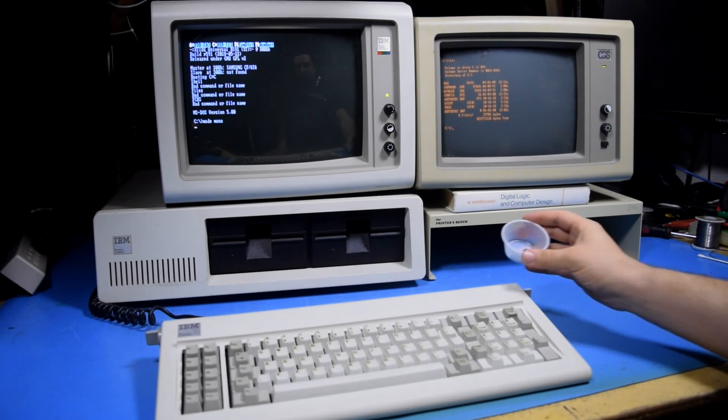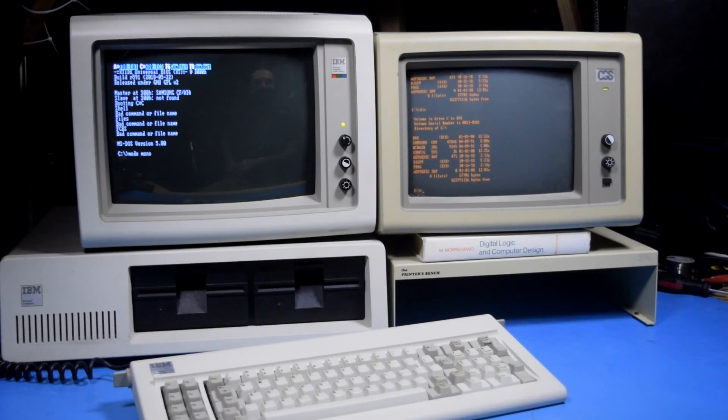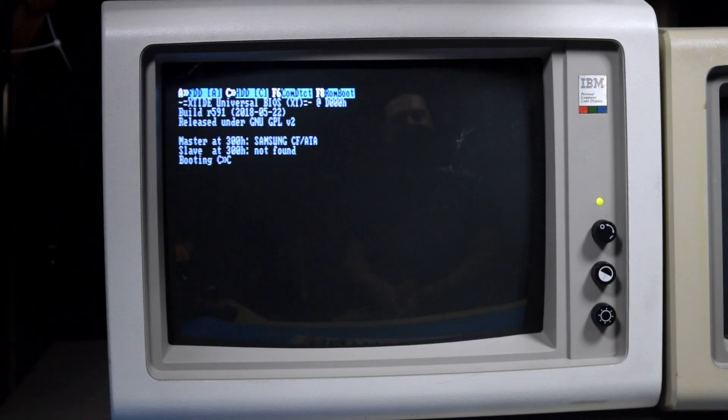Now that that is over with, we can continue. As I was trying to say before I was so rudely interrupted by the monitor exploding one of its capacitors: the 5153 also maintains a blinking cursor when it is not currently active, like the monochrome monitor, due to the Motorola 6845. I've been using the term 'active' incorrectly - that monitor is just the one currently being used by DOS. The other display adapter is still working fully in the background. The only thing the MODE command is doing is telling DOS which display adapter you want to write its output to. Since both display adapters are actually active at all times, they could both be written to at the same time.